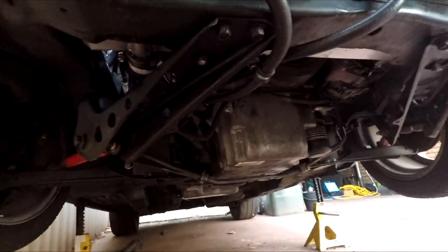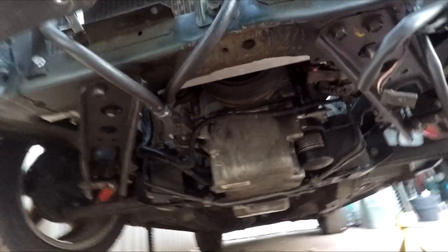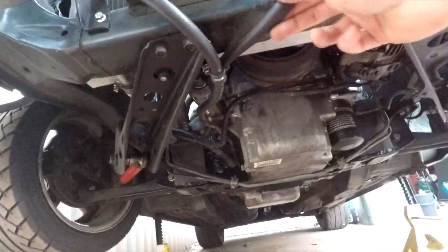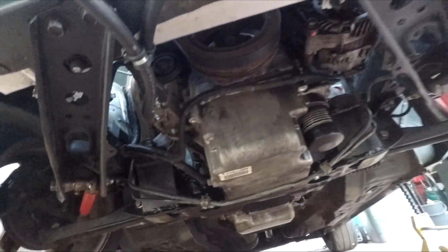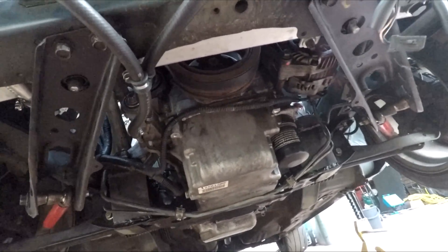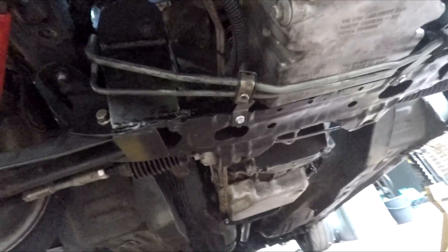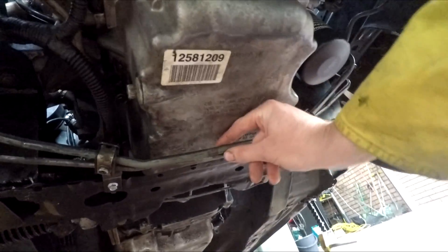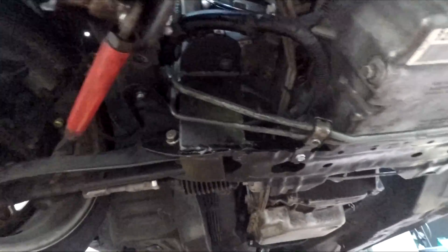Let me jump under the car and show you the line setup. For the transmission lines I've got rubberized P-clamps - looks pretty fancy and I don't want anything rubbing. To get the factory fittings off the transmission I just ground them off with a grinder, because the 3/8 fuel line fitting tool was too fat - you need something skinnier. For the power steering lines I've used the standard brackets, bent them and mounted them to the subframe so the lines are separated, nice and strong, and don't rub or vibrate anywhere.